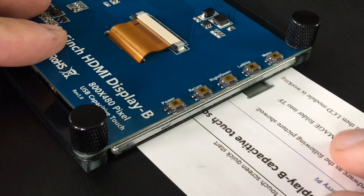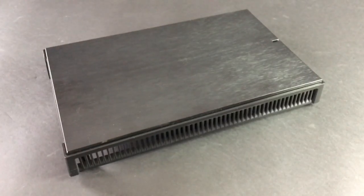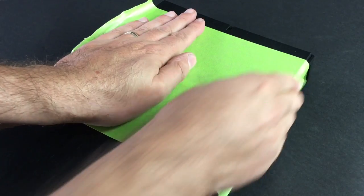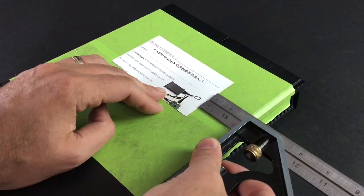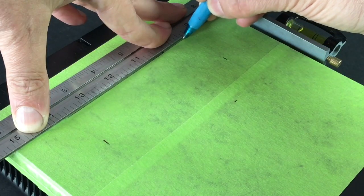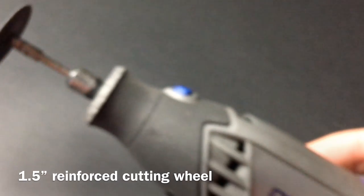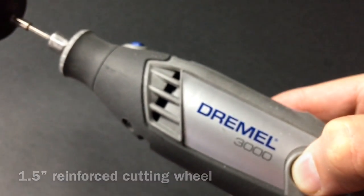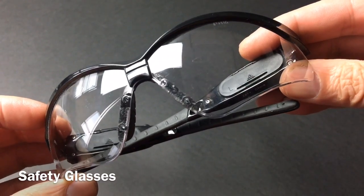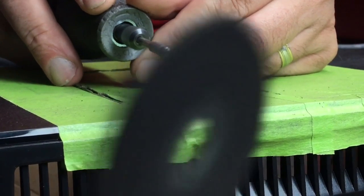See how this sheet of paper easily slides under the screen? That's perfect spacing for the LCD. The next stage is cutting out our opening into the PC bezel for our LCD screen. To determine the location, I like to use a measuring square. For cutting the opening, I'll be using a Dremel with a 1.5 inch size reinforced cutoff wheel from MNPC Tech. And don't forget to always wear eye protection when using power tools, just in case something like this happens.